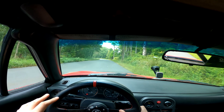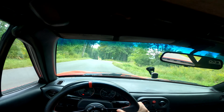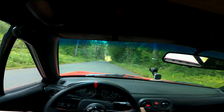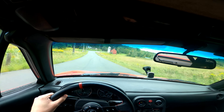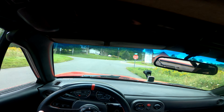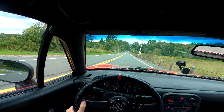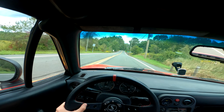We'll do a few runs just to make sure we're consistent and actually get the best out of this car. Right now this car is not set up with launch control — I have set it up before, but I stopped using it because I was worried about breaking the car. So we're just going to bring it up to RPM, dump the clutch, and go. With this specific car we're going to get some turbo lag doing that, because the turbo is sized a little bigger than I want, which is why I'm using that electronic boost controller to combat that.